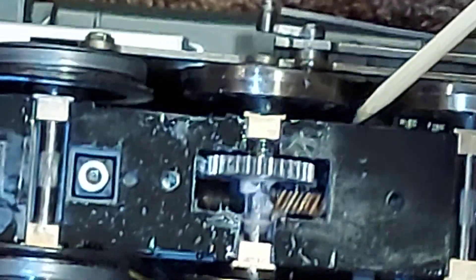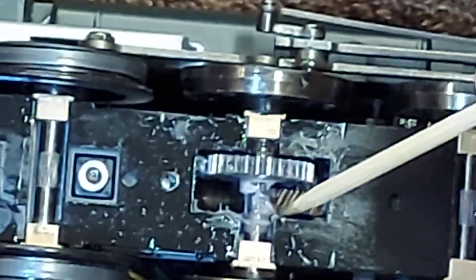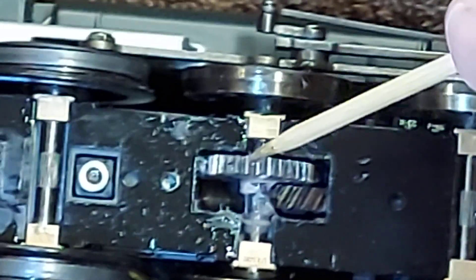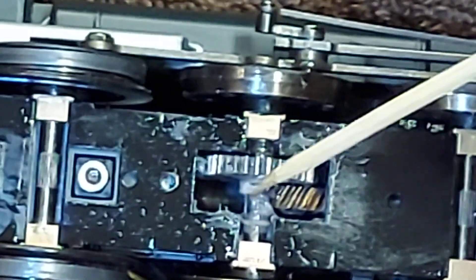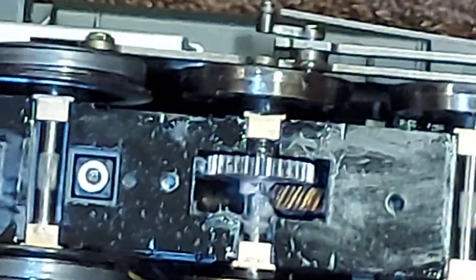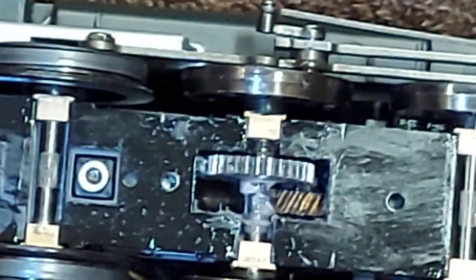On the H10 at least you can shoot some grease on the axle gear and it will transfer to the intermediate gear, and then you put grease on that gear and it gets up to the worm. But with the grease holes positioned as they are, unless you shoot a lot of grease in the very bottom I don't think it gets all the way up to that worm gear. So that's my concern — more moving parts, more risk of things going wrong.